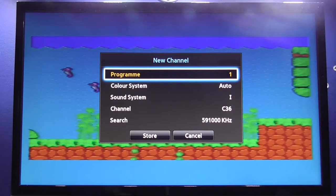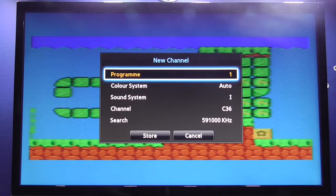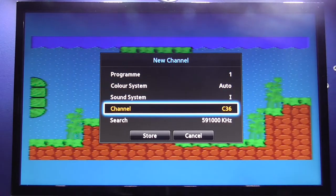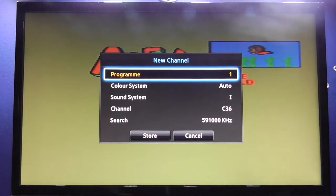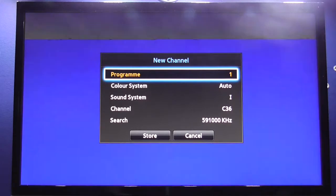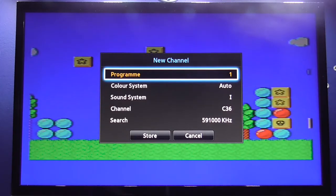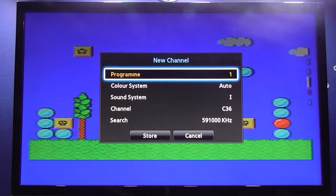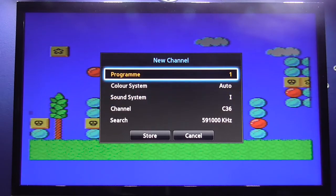You've got to be kidding me — there's nothing wrong with this Master System. It tuned in, Channel 36. Your guess is as good as mine as to why the guy put this on eBay as faulty, no picture. The only explanation I can give is maybe he connected it to a modern day TV that was purely digital. And if you do that with one of these old systems that only output RF, it's not going to work. You're going to need an old analog TV like this that can tune in old analog.